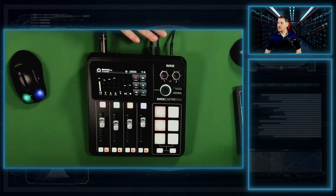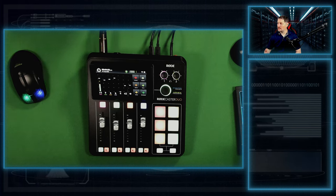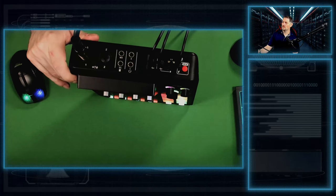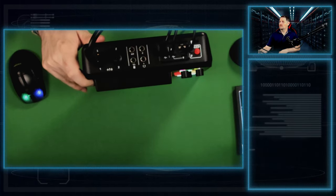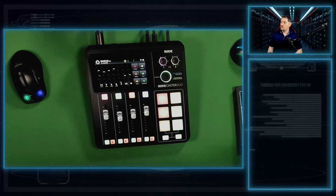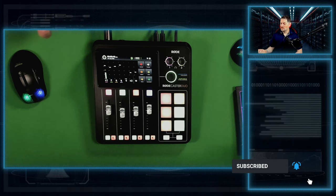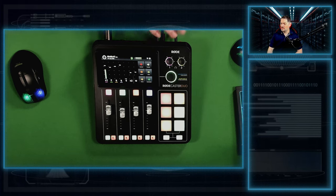As you can see, we've got two USB-C ports in the back right here. One goes into one PC for your main, and then the secondary is an incoming. We've got the XLR right here — this is port one, port two. Two headphones, and then a left and right channel for your monitor speakers. USB-1 and USB-2 on the back: one is for your main output, and then the secondary is to bring in audio from another source and to push out your mic to that secondary source.